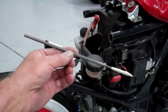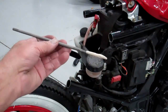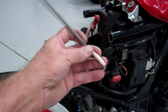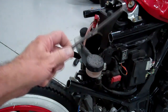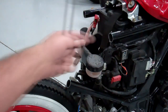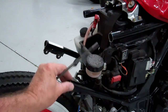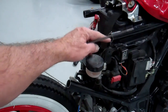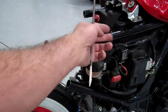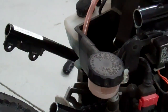We give you this file in your kit. Do me a favor and put some tape around the end here, unless you have a file handle — that's an awful sharp point and I don't want anybody to get their eye poked with that. Go ahead and put the file inside the tube and file the inside to get rid of all the sharp edges. Then go ahead and file the outside too — do both the outside and the inside. We want to get that nice and clean because we're going to epoxy some pieces in there, and if there's too sharp an edge it'll just rub the epoxy off.